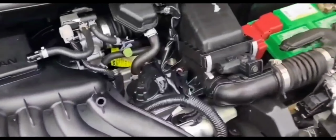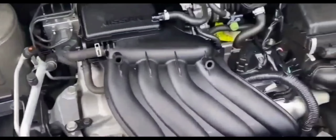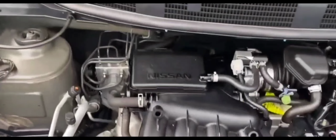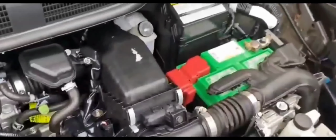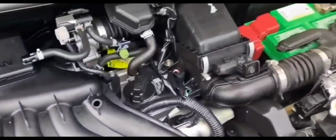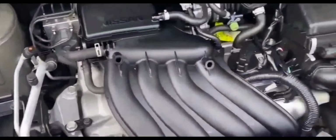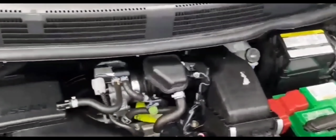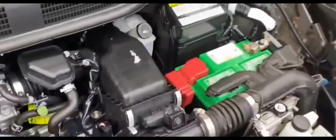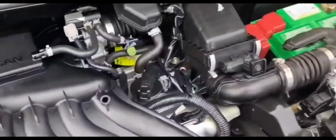So I was looking at the cables themselves just to look at them, and I noticed that the positive cable has this, it's called, what is it called? It's called a fusible link is what it's called. And now that I know that it's called a fusible link, but looking at it, they have these little tiny windows, mini windows. And if you guys look close enough, all of them actually has this little metal fuse wire that connects one end to the other. And I was looking at them, and a couple of them actually looked like they were burnt.